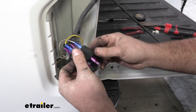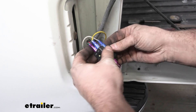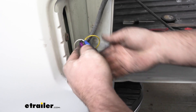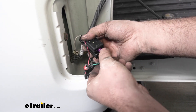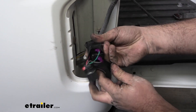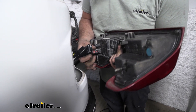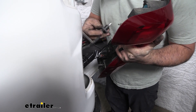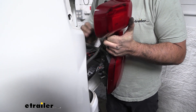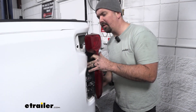At this point the driver's side has all connections made. What I normally do just to make sure these don't pull out — to make it more structurally sound — is take electrical tape and wrap it around so there's no tension being put directly on the spade connector or the wire. With that taped up, go ahead and reconnect the tail light, make sure you lock that back in, put the bulb back in, feed this in, get the tail light mounted back up, and head over to the other side.